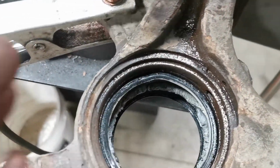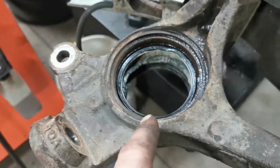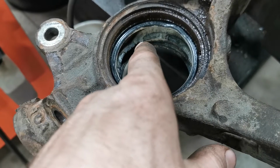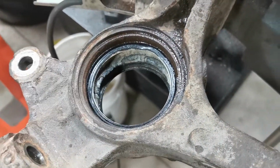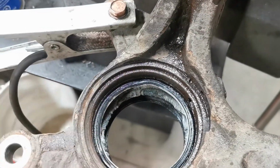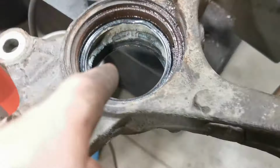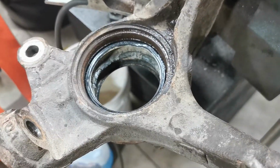And what that does is it takes the steel, it heats it up, but it also shrinks it. So then when you go and you hit that with a hammer, with a punch or an air hammer, it's gonna come out a lot easier. Some guys will go take a torch and cut a slit in it and then try and hammer it out, then they're fighting with it. I find every time I put a bead of weld around, it comes out 100%.